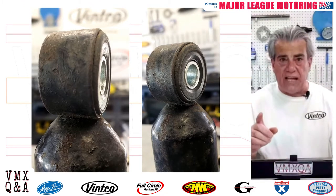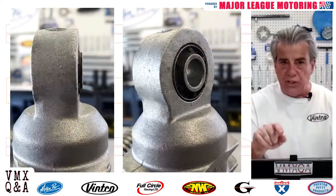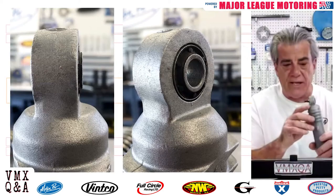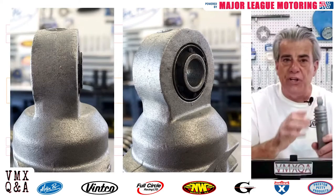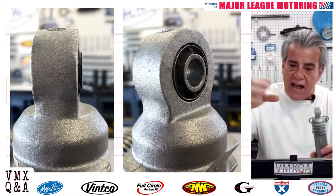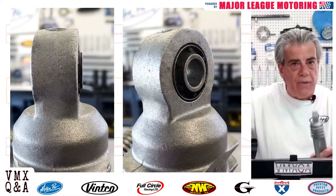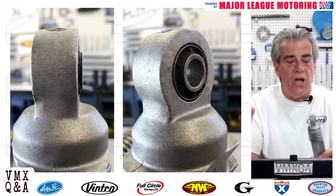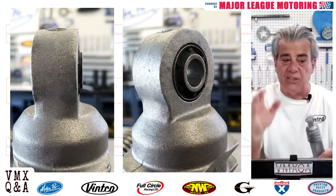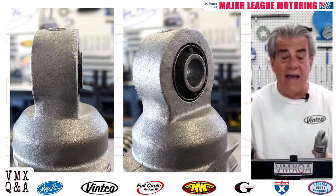Now, in the next slide, you'll see exactly what I'm talking about — this is the perfect case. Look at the steel bushing in that picture. I'm holding it right here too — it sticks out beyond the body of the shock. When you have that and it sits right down in that pocket of your swing arm or in the pocket on the upper frame, then you can really torque down on that bolt as much as you need to in order to keep that shock secure on your bike.